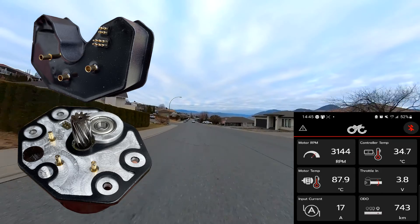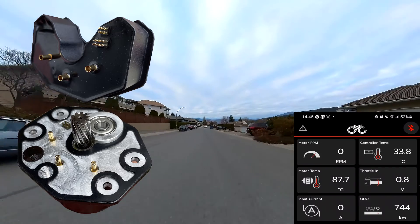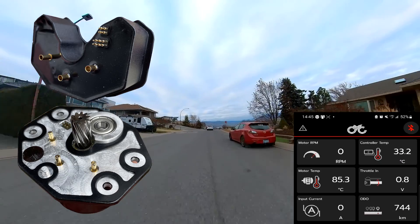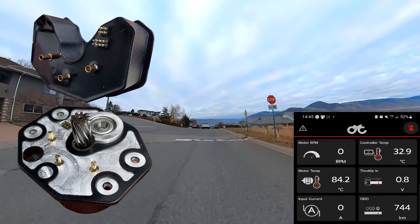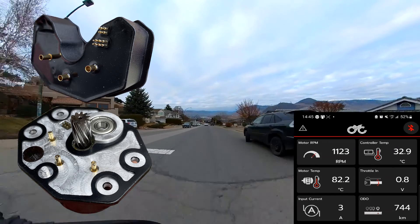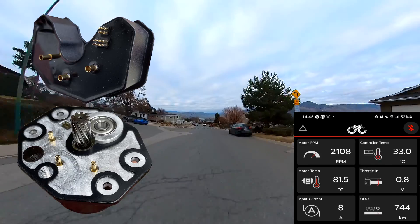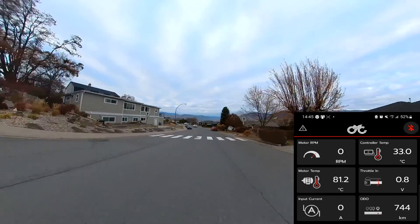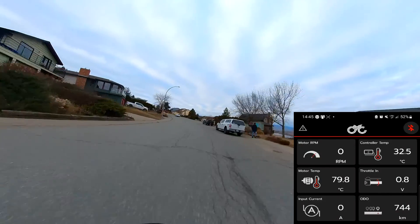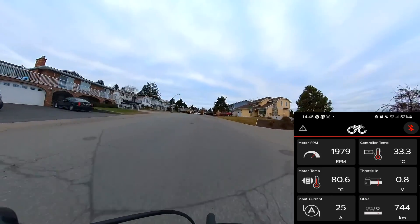There are some other aspects of the motor that aren't really helping with this either. The way the motor phases link to the controller is a very direct plug-in pin arrangement, which is another very direct transfer path for heat between the motor and the electronics. The Hall sensors also connect to the controller in a way I haven't seen before with an e-bike motor — they use spring-loaded pins which compress against contact plates on the other side, and again it's a very direct transfer path for heat. Usually these kinds of connections are done with wires and plugs. I think I understand why it's been done this way because the result is an extremely compact motor able to use a really wide range of chainrings and deliver a really good chain line — but is that resulting in an increased risk of failure?